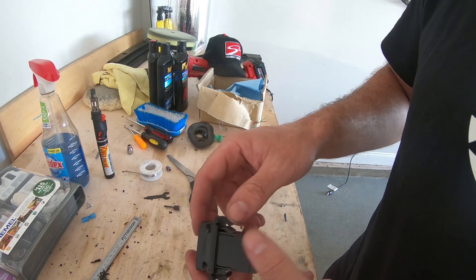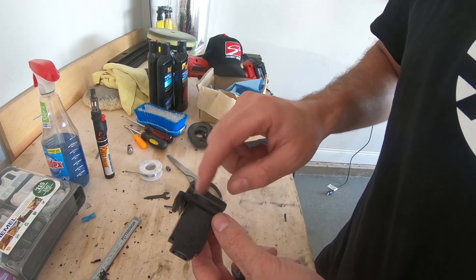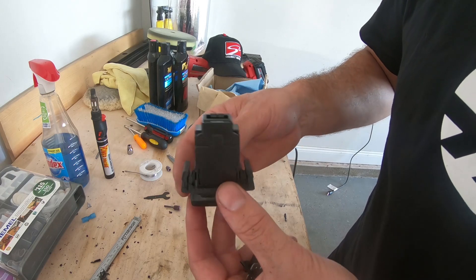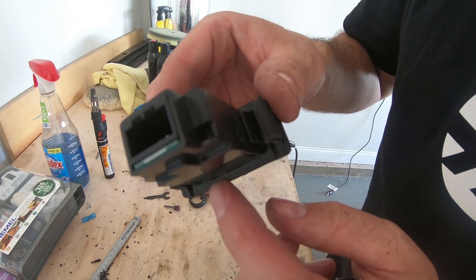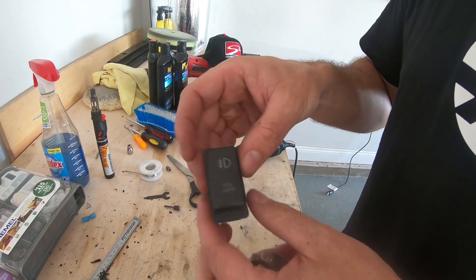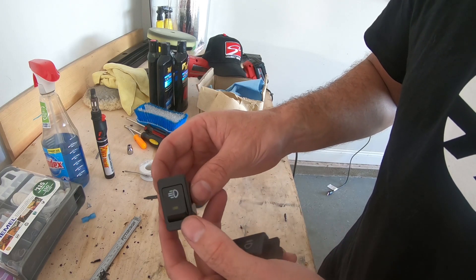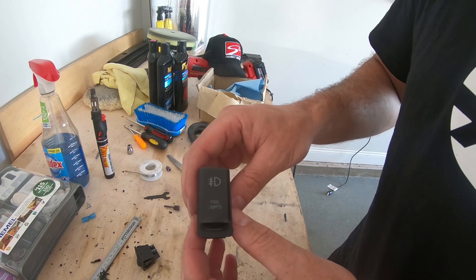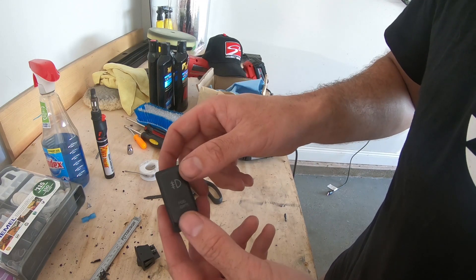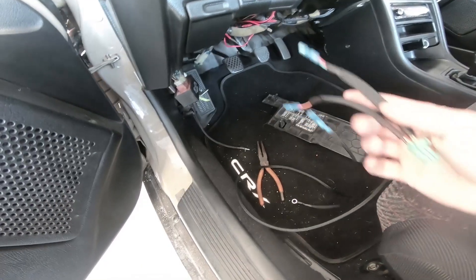Alright, so I thought I had it on record but it was still on a time lapse. It fits pretty well inside there now — it's pretty snug, it ain't coming out. These are the Greg Parts replacement ones; they're a little beefier than the original ones which is good in my opinion. You can kind of see how much wall thickness is left on each side — maybe like a hundred and fifty to two hundred thousandths. The debate was between this switch or this switch. This switch turns on and just kind of sits like that in your car — that would light up when the fog lights are on. This one wires up so when my headlights or instrument lights are on, it's lit up white, and then push it in and it'll light up the fog lights too.